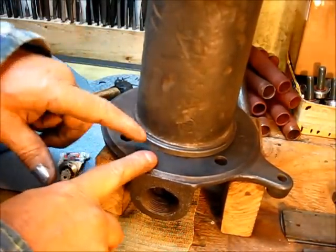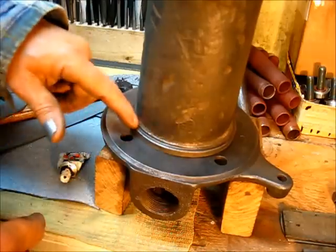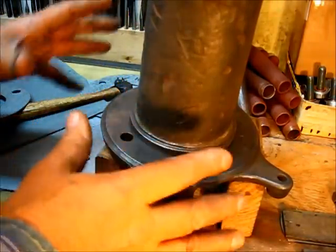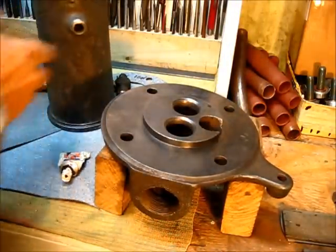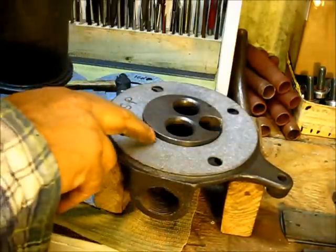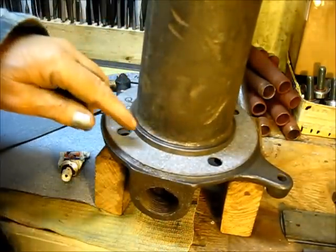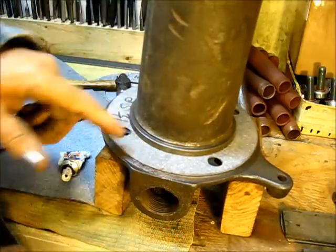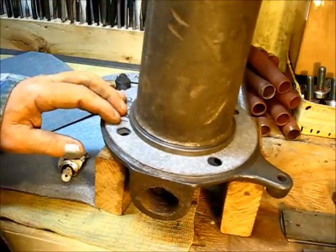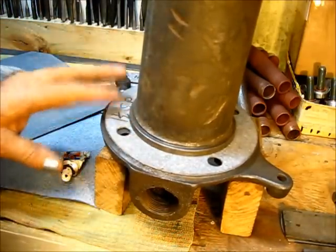The water will be in the hopper, and there is no O-ring or gasket that goes here. The part that seals that cylinder, that little half an inch right there, is what seals the water from the piston area. That's the way it works. Put a little sealer on there. You'll be well rewarded for your efforts.